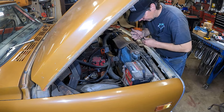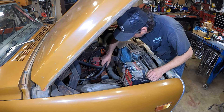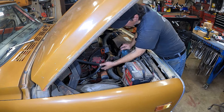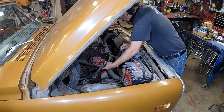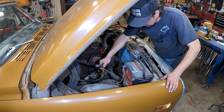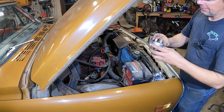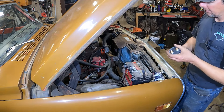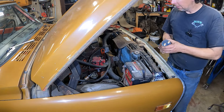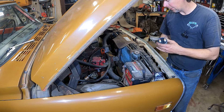This battery is only a couple years old, but I've been disconnecting it and reconnecting it every time I use it, and that's getting to be a pain because I don't trust this truck to not eat the battery. So I want to put a disconnect on it. Also, the ground cable is about shot. I ordered one of these kill switches — I put these on every single vehicle I got because they're a good anti-theft device and they make it so you can disconnect the power. I shut off the power every single time I leave a vehicle because there's less chance of a draw, less chance of a fire, electrical short, or anything.